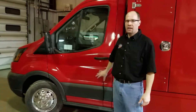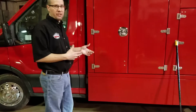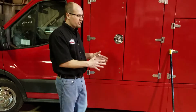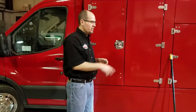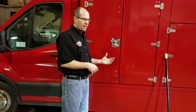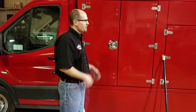Being built on a Ford Transit and using aluminum to keep it lightweight, this truck can stay under 10,000 pounds. It's split-shaft driven — there are no extra engines. The drive line comes off the back of the transmission into a transfer box, and then another drive line goes from that box back to the wheels. When you want to run the unit, you disengage the wheels and engage a PTO attached to the side, which turns your unit instead of the wheels.